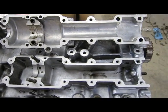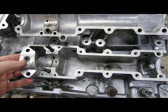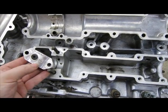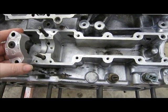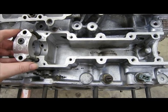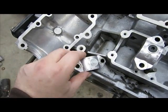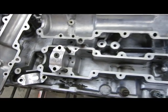The intake side of the engine - which is the side we're working on - has a little rubber grommet on the end cap, because on a turbo engine the oil feed goes from the balance shaft journal through the cover and to the turbocharger. This side also has a number two stamped on the end cap, as opposed to the other side which has a one on it. The cover on this side has a corresponding boss with a hole in it that goes against that oil grommet, while the exhaust side cover does not have anything machined in that boss - so you can figure out which side they go on that way.